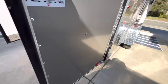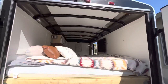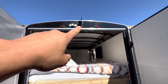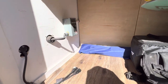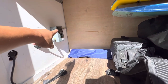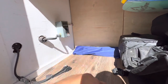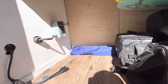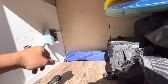Moving around to the back — there's a wireless rear backup camera so you can have a small screen inside your vehicle to see what's behind you. This is the 30-amp box: one circuit is dedicated to the AC unit at 15 amps, and the other powers the refrigerator and everything else, which keeps the generator running efficiently.